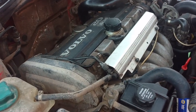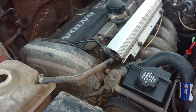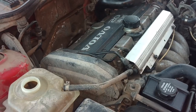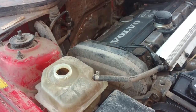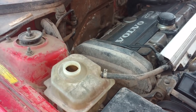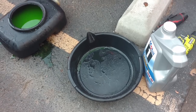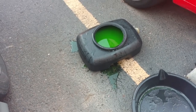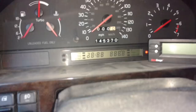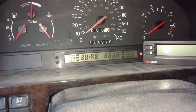This thing was not heating up properly, so I replaced the thermostat. I'm going to put all the coolant in here and take it out, make sure it warms up, stays warm, burp it, bring it back, and top it off in the morning. Whenever the radiator doesn't have the proper Volvo-style drain, I use that big pan to catch it. Looks like I got a dead battery — I turned the key and lost my clock. Let me go find my jump box.